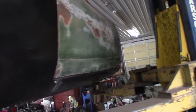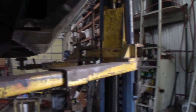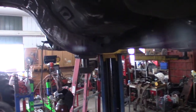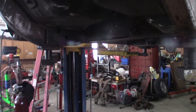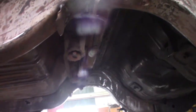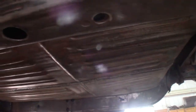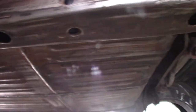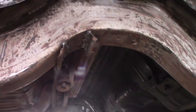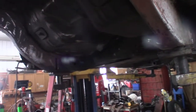You're gonna use that waxy stuff for that? Yeah, they got some kind of paint that you stick down with a long tube, pull it back through and it sprays everything. You gotta do that inside the frame channels everywhere you can. I did - and I had them apart, I did a chassis saver. Yeah, inside of them is chassis saver inside my frames. You can see it a little bit here - it's black. I went crazy with that, and so the inside down into here is all sealed up really well. It's never gonna see salt again.